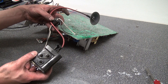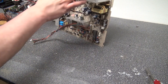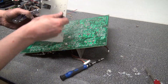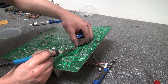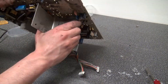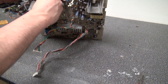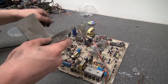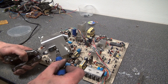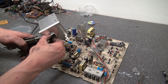This thing is beautiful — very dusty and dirty. I'm going to need to use isopropyl alcohol to remove all that dust. I'll put it in my component pile. Now I have the circuit board with all the components. I'm going to desolder that metal panel attached to it and take out those MOSFETs as well. Right now I'm just focusing on desoldering the big pieces and major components that I want, like this aluminum plate — to pull out that MOSFET inside. That MOSFET is a high voltage MOSFET and can be very useful.